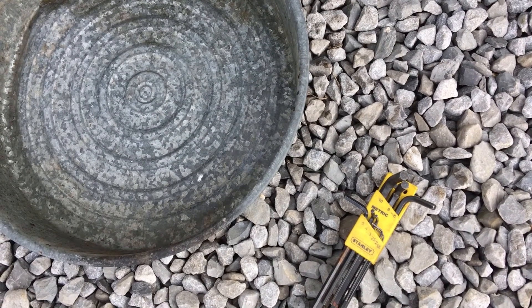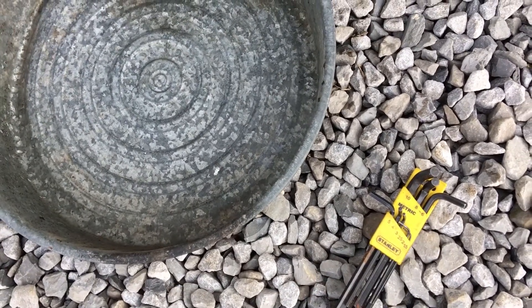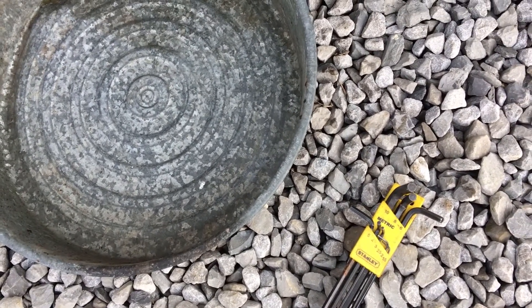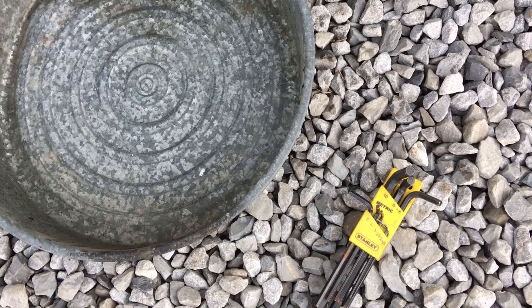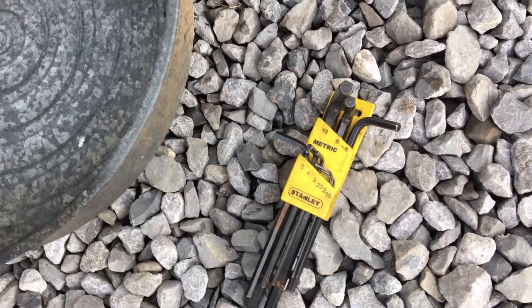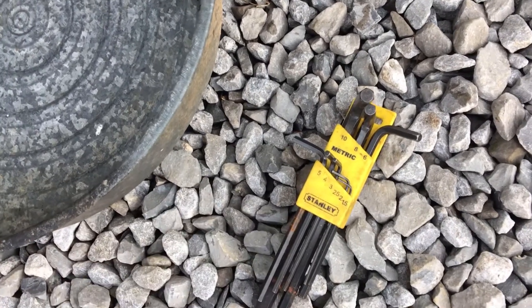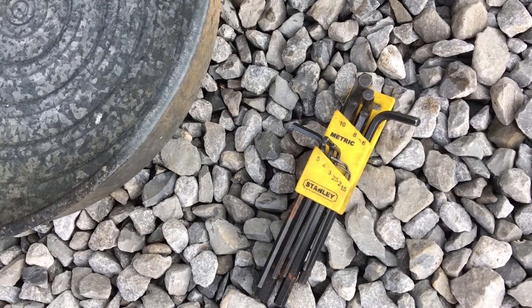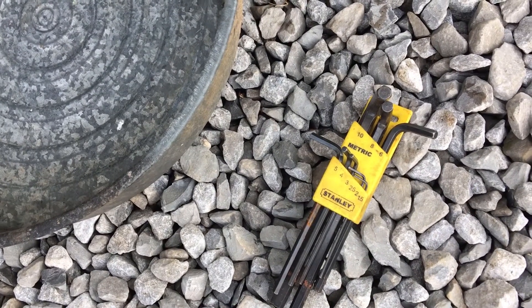I've got my drain pan. I'm wearing black gloves — make sure you're wearing work clothes; it's kind of breezy out here and you may still get diesel on them, so don't wear your good clothes. We're going to use a six millimeter metric Allen wrench to pull this plug, and I'm going to crawl under there now and show you how to make this thing work.